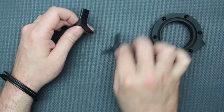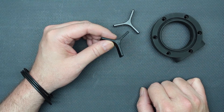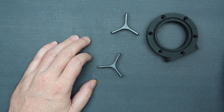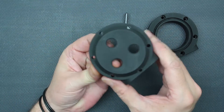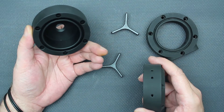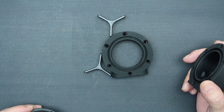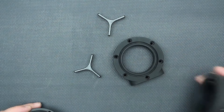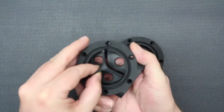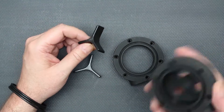So they eliminate or reduce the vortex inside a reservoir, and they can also help you eliminate or reduce any kind of splashing noises if you're trying to do a really quiet build. They work with any of the molded end caps — they'll work with the fill drain port, the bulkhead connector, or the coupler, which is what we call this. Basically, any of the molded parts you can press one of the tridents in. They also come in molded white for the white end caps.